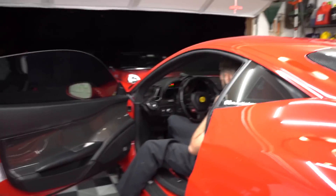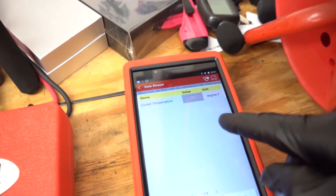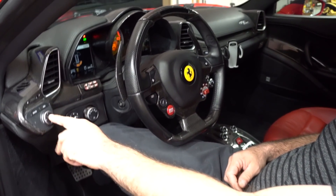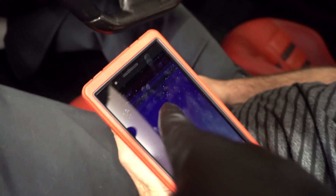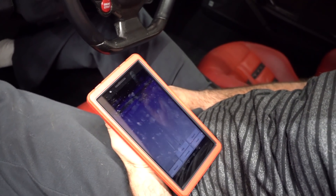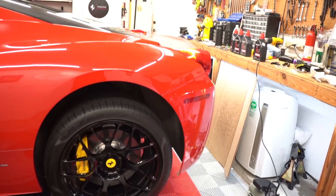Josh has the car fired up. We're waiting for coolant temperature to get to between 100 and 120°C, and making sure DCT fluid temperature doesn't exceed 80°C. The car should be in reverse with foot on the brake. Coolant temperature is already at 102 so we go check it — and there's definitely no fluid coming out. As expected, we need to add fluid.